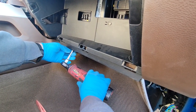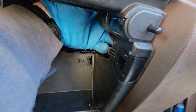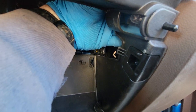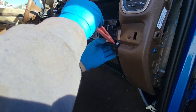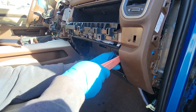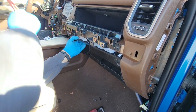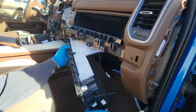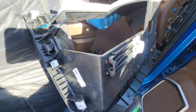There's going to be a plug for this light switch — ours is a radio plug. Now we're pulling this thing out. There's the light switch. It's held on by plastic clips once you remove the two screws in the bottom, so you just pull it towards the back of the car.